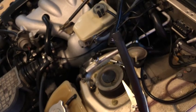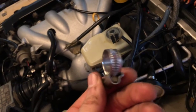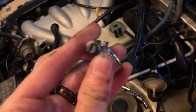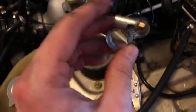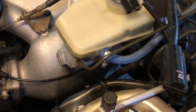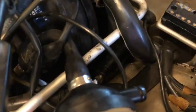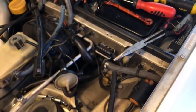I already had some hose in the garage so we will cut it down to size and use it. I need one more clamp — I'm one short, so I'll probably have to go to the store just for that. For now I'm gonna steal one from my vacuum line, put it on the clutch feeder line, get that hooked back up, loosen it, swap out the hose for the new one, and then go back in and hook that pin back up. We'll contort and finish it out.